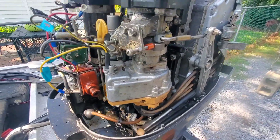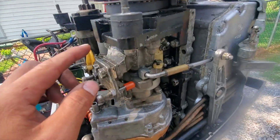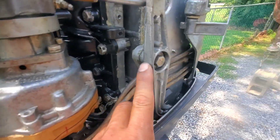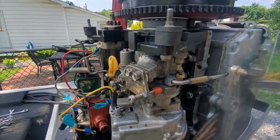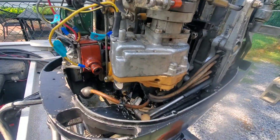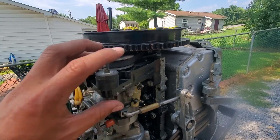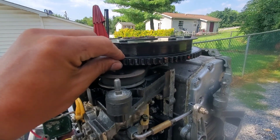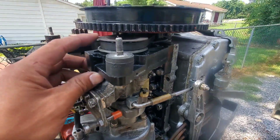In the next step we're going to be removing the Energizer distributor right here. I'm just going to unscrew this — one, two, and a bolt back there, three — and that's just going to pop down. We have to disconnect it here and then get the plug wires out. One of the major differences I've seen between the Energizer version and the breakerless version is that it has a thicker mount up here. The actual pin had to be created higher, which could potentially hit this flywheel, so I'm going to have to figure out a solution for that. Other than that, it should just be plug and play.